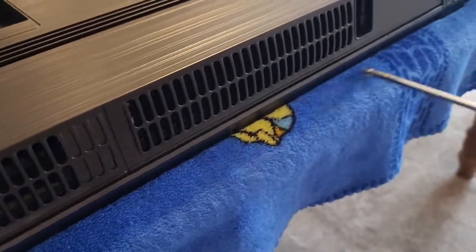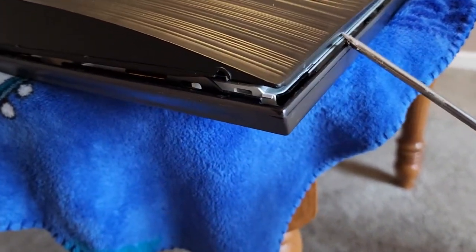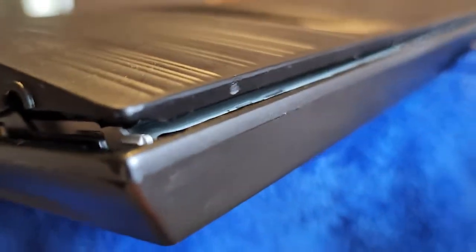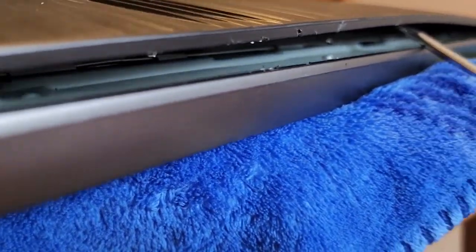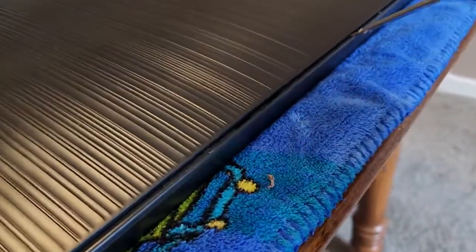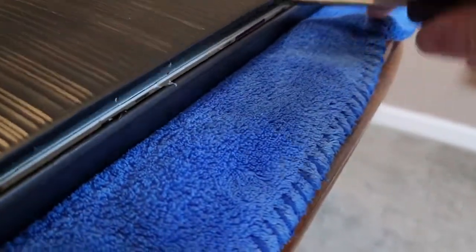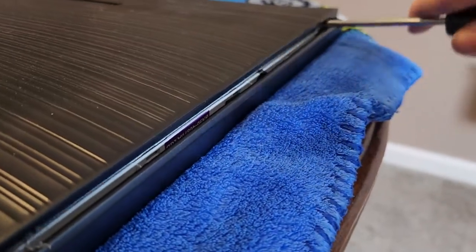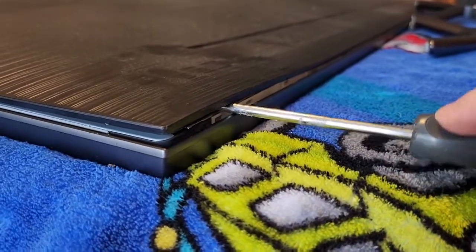You can go along through here with your screwdriver and pop it apart. This came off fairly easily. I started down here and started prying, and it scared me a little because it makes a pretty good pop noise when it comes off. What it is — you probably can't see them in there — there are little black tabs that pop out. I'll show you what it sounds like right here. Did you hear that? It's just popping the black tab out of the frame.